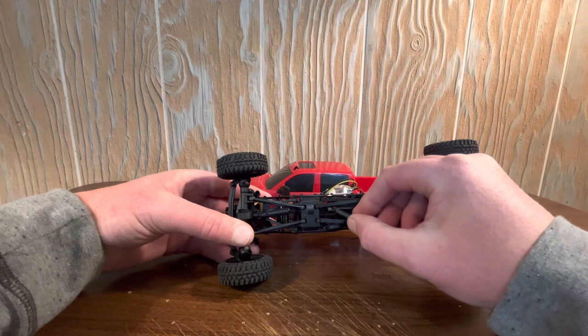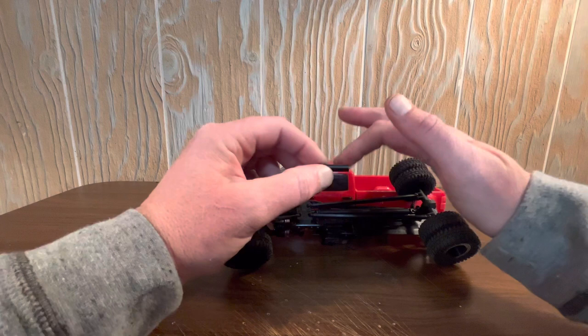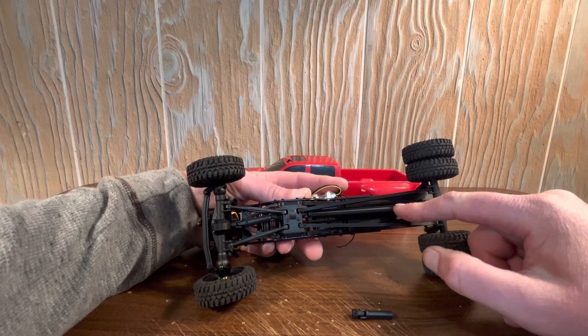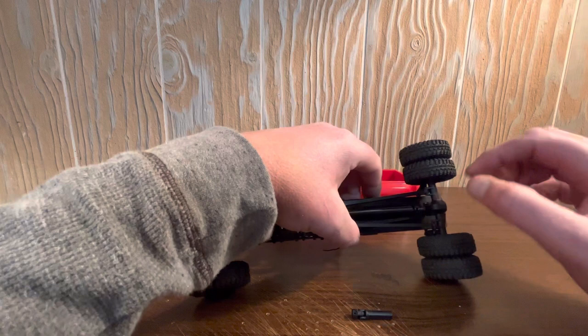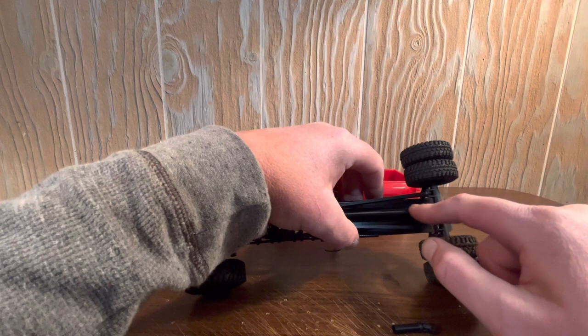But that's connected here to the back of your transmission. So all you've got to do is remove this and cut your tube in half. Just cut it in half. And then your piece that doesn't have your yoke on it, you just put some glue on the end of it and around the edges, and slide it in the end of this tube. I tried to look down that tube with a flashlight to see what that stopping piece was. It looked like a piece of wire mesh. Don't hold me to that. I'm half blind, so I'm not real sure, but once you push your stock tube into the SKP Engineering tube, there is something where it'll stop. But you just push it in that side and let the glue dry.